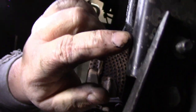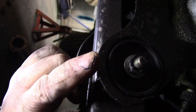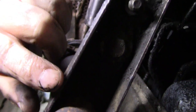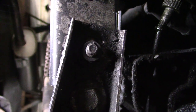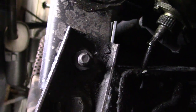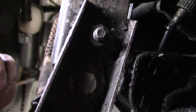Okay, let's see what you can see. So here's that transmission, the rubber bushed transmission mount, and here's the bracket that's got a couple of fasteners here that holds it to the pipes. So we'll undo these two fasteners and then this should be loose, and we'll try to feed this exhaust manifold back down this way and see if we have enough clearance. Wish me luck.